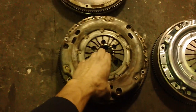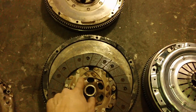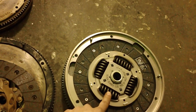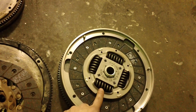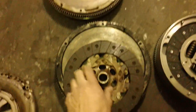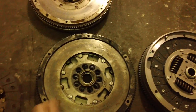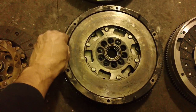So here's one of them. On the clutch disc, you'll see it's got a solid hub — there's no springs on the inside. Traditionally, you would have a clutch disc with springs in it to take up for when you give it gas or let off the gas and push the clutch, so the car doesn't jerk around. But what Volkswagen and Audi decided was that instead of putting the springs into the clutch disc, they would put it into the flywheel. So when you give it gas or let off the gas, the flywheel moves because it has springs in it.